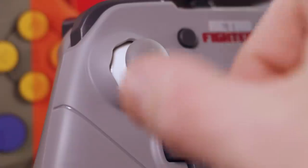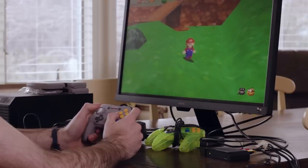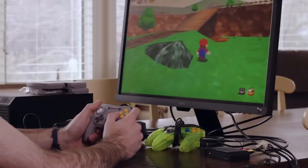I know it's probably modeled after the GameCube controller, but I am not feeling those jagged edges. Eventually those will rub down. Even without bringing the thumbstick all the way to the edge, it felt like Mario only moved in 8 directions, not a full 360 degrees. So these divots do make a little bit of sense, but after a little research, it turns out the N64 controller uses two optical encoding disks to determine the direction you're moving. The N64 can read all 360 degrees of movement, so there is no reason to have these divots — it should have been just a clean circle all the way around.